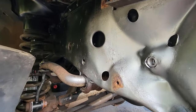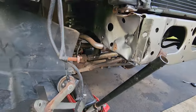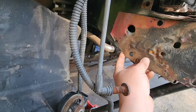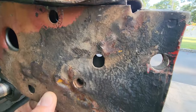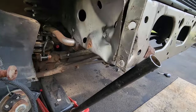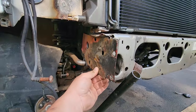And this damage, this is what I'm gonna have to address tonight. You will see the results of this in the next episode of The Toad, hopefully. I'll show you right now what I got in store. Check it out right here. This is what I got. Just a piece of XJ frame, took out of a parts XJ. If you line everything up the way it should be, you can see that this was pushed in a little bit. So I went ahead and I split this frame rail, and I'm in the process of pulling this piece out. And then I'm just gonna weld this baby back in, paint it all to match, and this sucker is gonna be a nice, complete factory XJ frame once again.